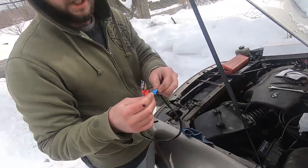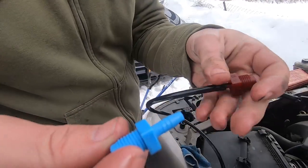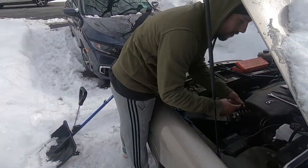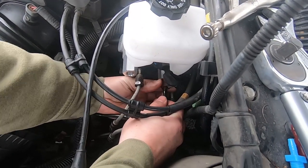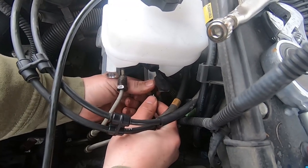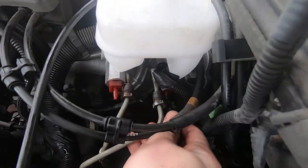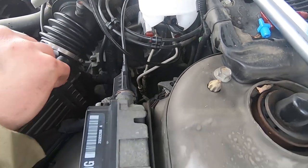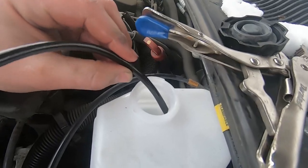These fittings have three ridges — it's definitely best to go over all three. That way you don't have any type of air coming through the hoses. You want it just like that, snug over the fitting. They go exactly where the hard lines go. When you tighten it up, you don't want to tighten it too crazy. You also want to make sure it's threading in perfectly, because this is plastic and you don't want to strip it. Put these back on the fittings — make sure it goes over all three, just for safety. Then take the end of this hose and put it right back in here. It's good to go as far back as possible.